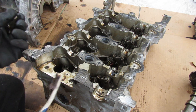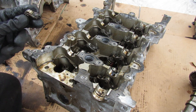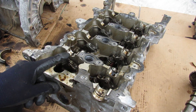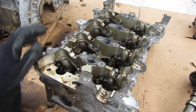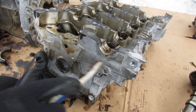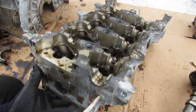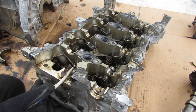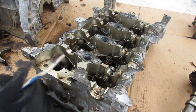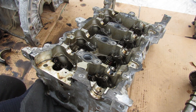Taking a look at the engine head assembly, this uses roller rocker arm systems. You've got the valve spring over here, and then this roller rocker arm bridges the gap between the spring and the camshaft, which acts on it directly. Underneath there's a hydraulic lifter powered by the oil galley, one on each side. That allows oil to flow up to the rocker and take up any slack between those two — so you don't get that tap-tap-tapping sound, and it means you don't have to do a valve adjustment.